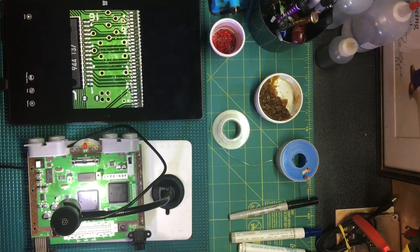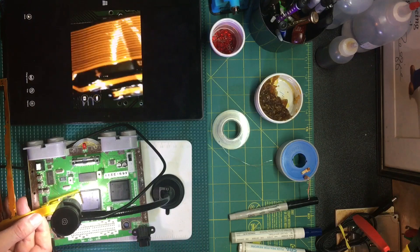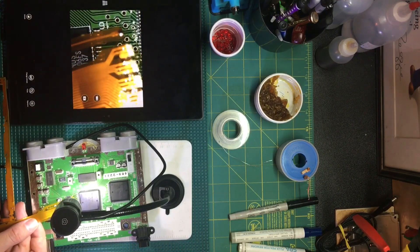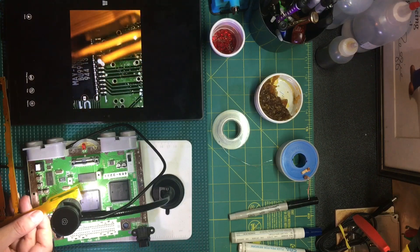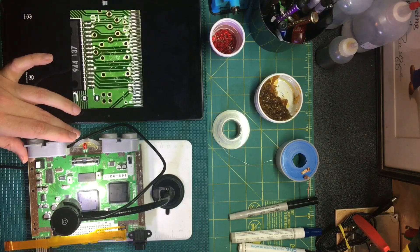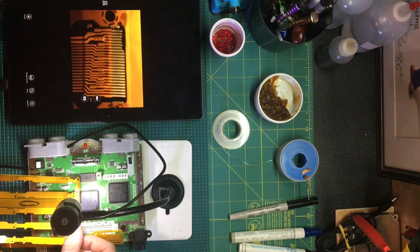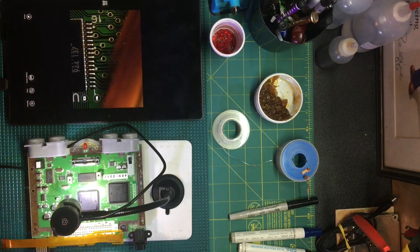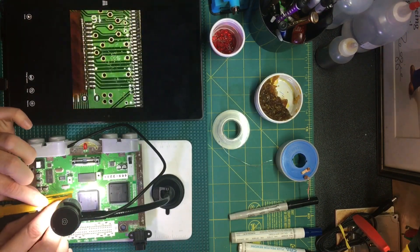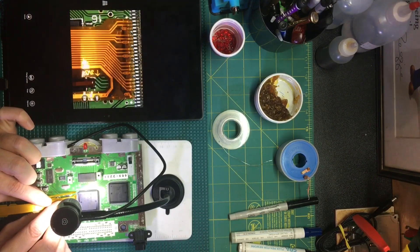Let's add Ultra HDMI to another N64. This is my last good Ultra HDMI flex from the sheet I used during the live stream. I've already tinned the little wings that go to read your controller — the bad one is still on the sheet. The little wings are for reading your controller and getting five volts and three volts.